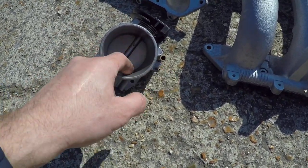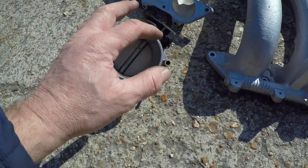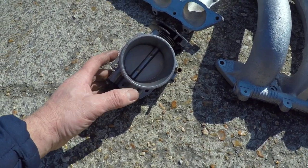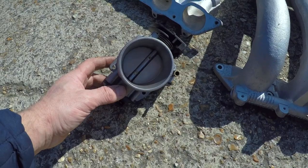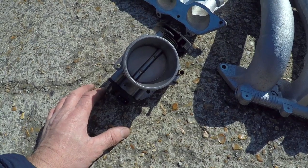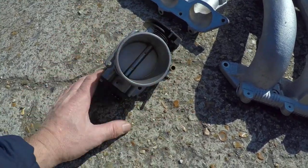So taking this off, you don't see much, but it does run a few points leaner. But combined with the air box and the air filter, you do see a nice performance gain at the top end, over 4 grand. It does hold on to the torque a bit more and produces a bit more power. But for this, we're not going to go crazy. We'll just take maybe half of this off, so it's still in between. But yeah, maybe I'll see how I feel. I might end up just taking all of it off, but we'll do that in another video.